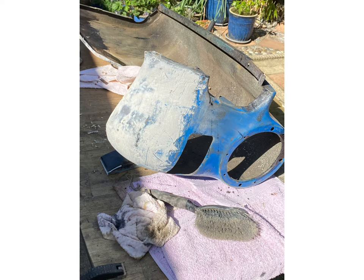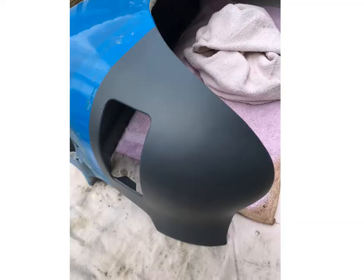This is another part of the wheel arch that we couldn't weld because it's a curved section. We were a bit skeptical about repairing it, but we treated it with a rust adhesive, sanded it all down, put rust proofing on it, filled it up, and then put some stone chip on. I think it looks quite smart.